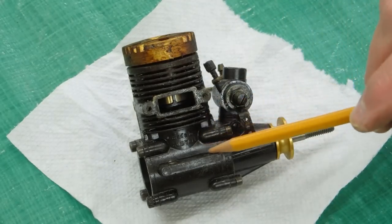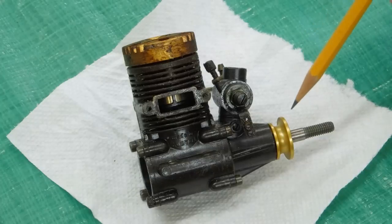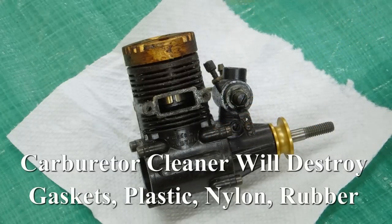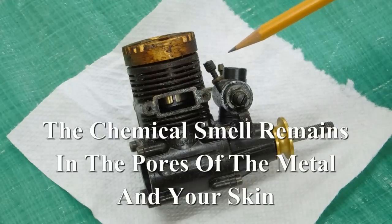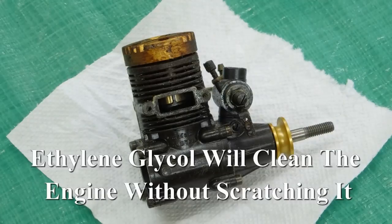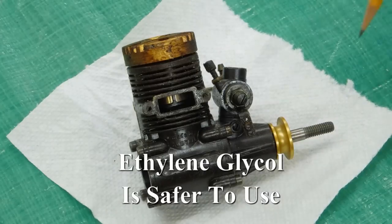This engine is black and I'm not really sure if this is a form of powder coat or if it's anodized. You can use carburetor cleaner — get a one gallon can, take a lot of this stuff apart, and dip it in there — and it will certainly take off a lot of it. But I have found that ethylene glycol does a better job on removing some of these burnt-on deposits and carbon than what the carburetor cleaner did.